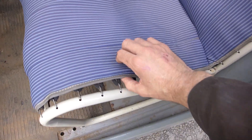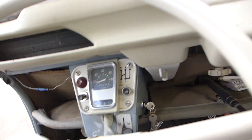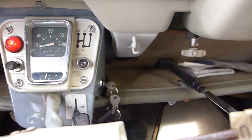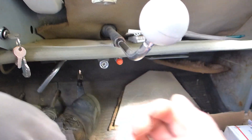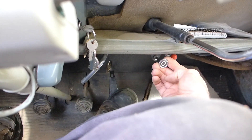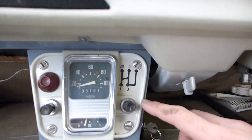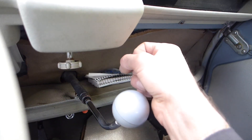We're going to start her up. I love these seats that have the little cords — that is your seat cushion. So you're sitting behind the dash, and what you do is simply turn the key to on — see the red light come on there and the fuel gauge rise. Then underneath the dash in two places: there's the D, which in French means start — you pull it out, which engages the starter. On this side is your choke. She's warmed up so we're just going to pull the choke. Fired right up! The gear shifter actually comes out of the dash: push it in for reverse, pull it back for first, in again for second, out for third.